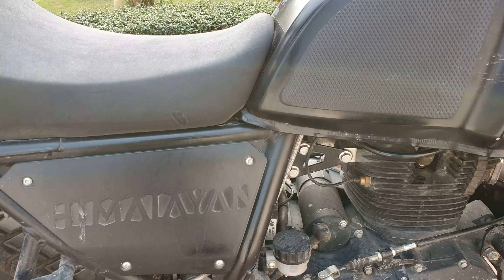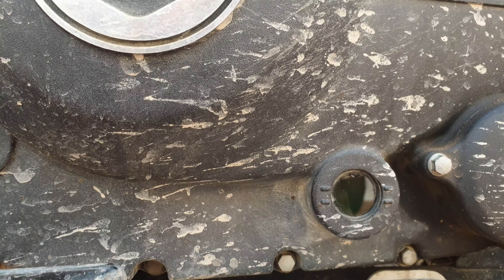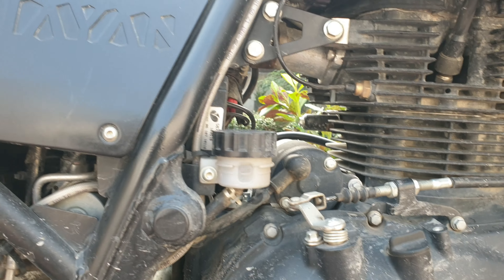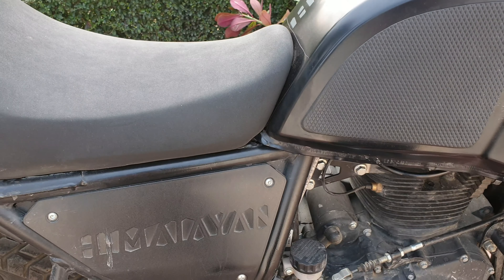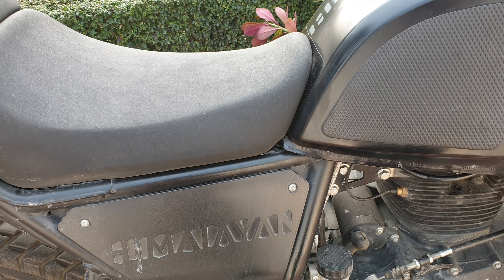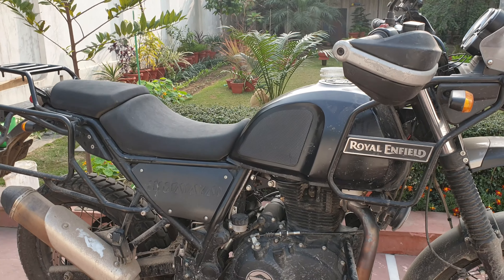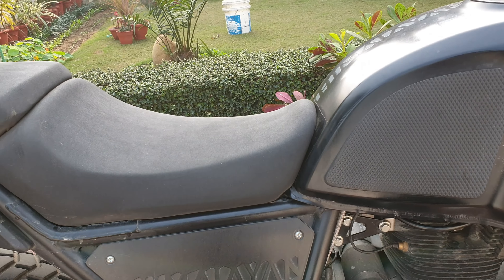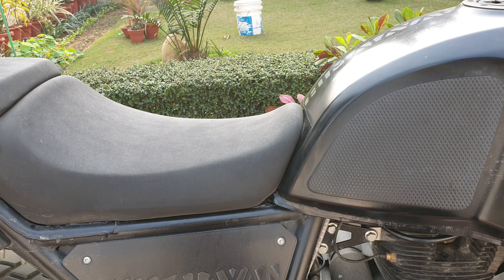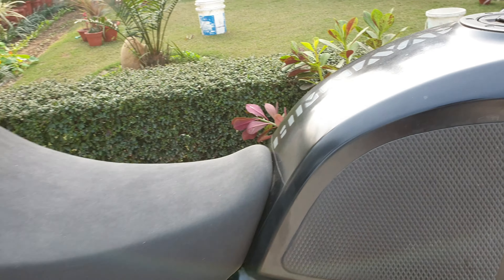Tank is in, bike is good to go. I'll start it, but first — I've also changed the engine oil, that was about 600-700 km back, done at around 12,500 km. Motul 300V, cleaned and changed the air filter, cleaned the spark plug as well. Before I start, remember: tappet adjustment is to be done at compression stroke while the piston is at TDC — Top Dead Centre — meaning the piston is all the way up, compressing the air-fuel mixture. Intake clearance recommended by Enfield is 0.08mm to 0.10mm, and exhaust is 0.23mm to 0.25mm.